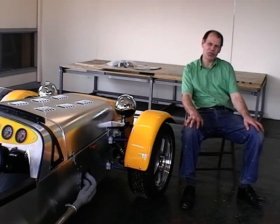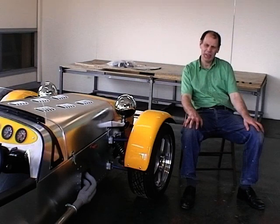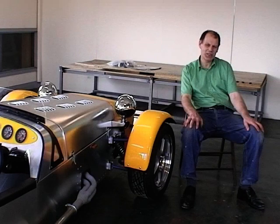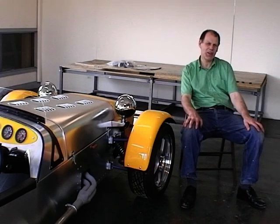Remember that there is a 100mm exemption zone around the steering wheel, so you may want to fit the demo vehicle's steering wheel. And inside the car, there are various internal projections that we do need to keep well radiused. Remember, it's a good idea to try to get hold of the SVA manual, because that is right up to date, and any new points, any areas amended will be in that manual.